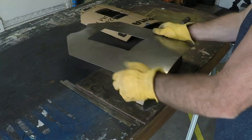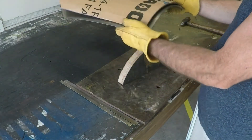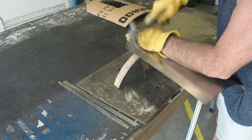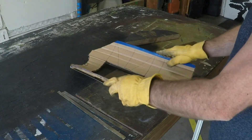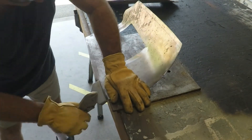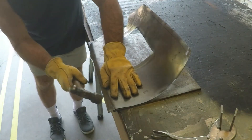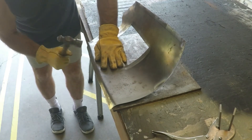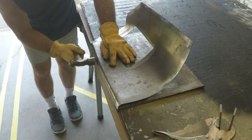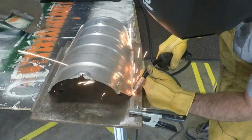Let's create the bend in our shield. It looks like I got lucky this time — my metal part looks just exactly like my template. Next, we need to bend the outside half inch on both sides. That about does it for shaping the shield. Next, we need to weld our metal strips onto the heat shield. A series of spot welds works just fine.